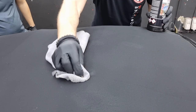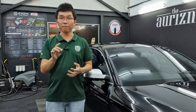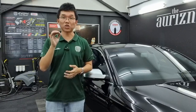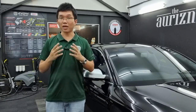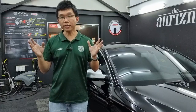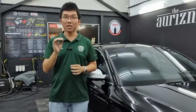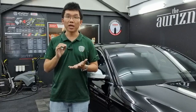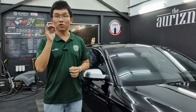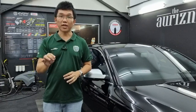Some stains can leave permanent marks on the soft top, so it is important that you know when to stop, or recognize that you have done the best you can. Soft tops are especially sensitive to marks in areas where they fold, so there are some stains where there's really nothing you can do. Also, when you are cleaning the edges, have a damp cloth on standby to immediately wipe off any drops of solvent if they flow off the soft top onto the car body or plastic trim parts.